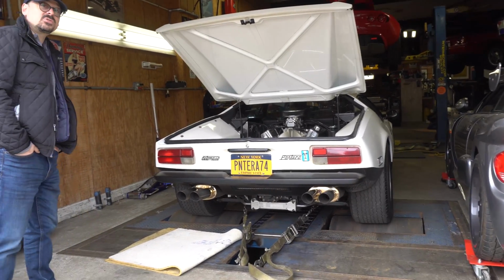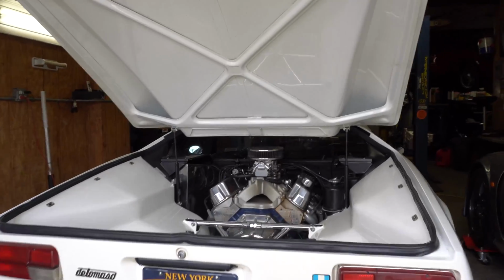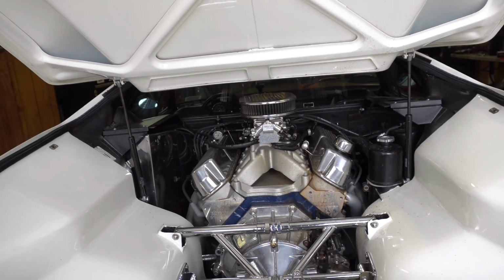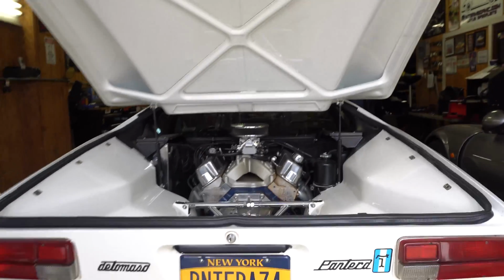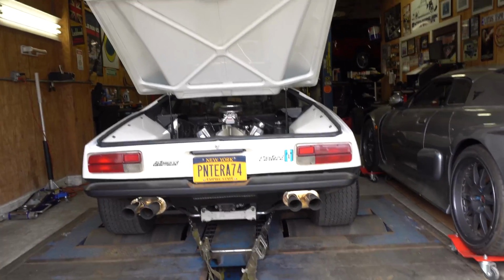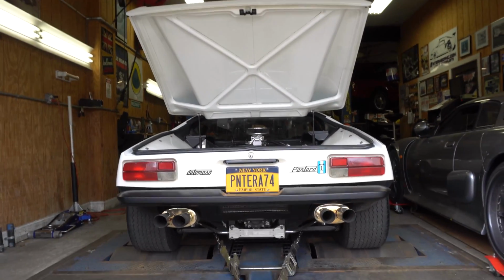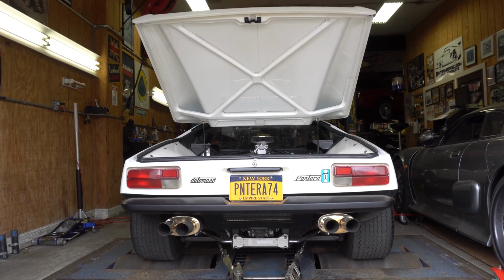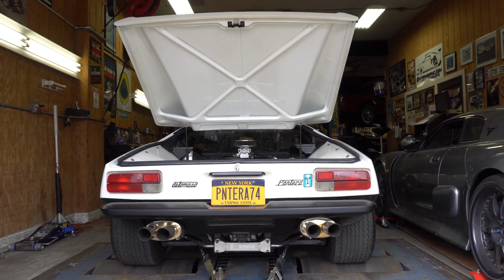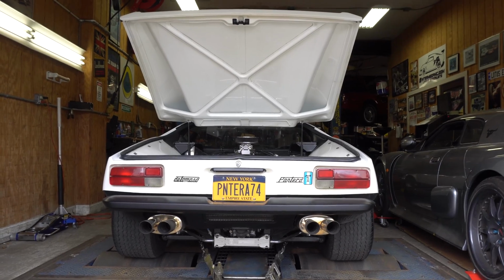And the transaxle is a nice transmission. The transmission will actually take 800 or 900 horsepower. Wow. Is it a 4-speed? Actually, it's a 5-speed. And the fifth gear on this was replaced. It's a lot taller, so it's much more comfortable on the highway. Nice to cruise with. Yeah, perfectly pleasant. You can run, like, 80 miles an hour at 1,200 or 1,300 RPM. That's a very comfortable, just above idle kind of speed. The exhaust is not too loud like that? Oh, that's perfect.